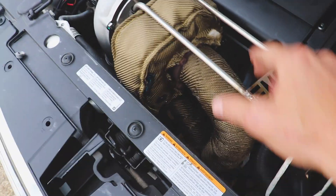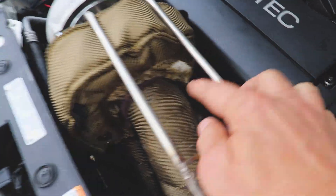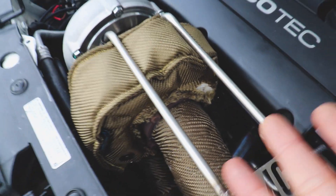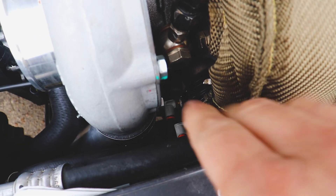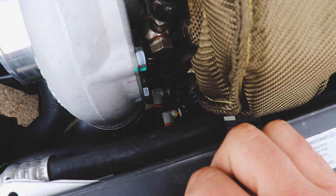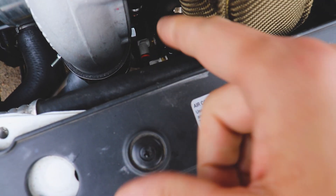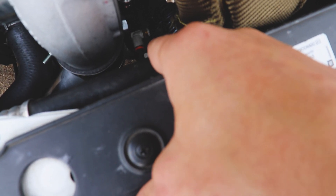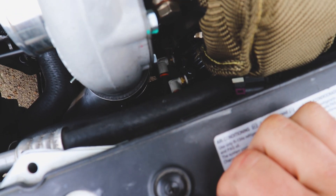I think I'm going to take the turbo manifold off and wrap it, like we've done before. I did tear up my turbo blanket a little bit, so I'm going to replace that as well while I have everything off. One of you guys made a really good point about the push-to-connect fittings — with our wastegate down here, we do have plastic fittings. I have some metal push-to-connect fittings, so while we have this thing off I'm going to replace those with metal, just to make sure we don't have any issues.